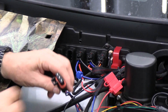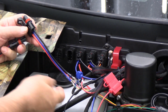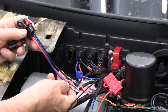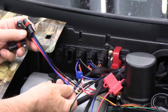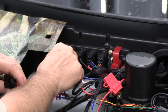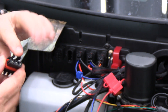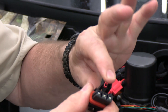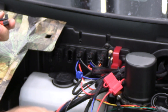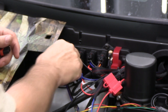I've taken this one out — you can see how easy that is. I've got the wires to the backup camera soldered in place. I'll show you those connectors that work really well — they've got built-in solder, heat shrink, seal and solder. These literally just fit right into the pulse bar; they snap in with this snap here, and to release it you lift up and pull it back out.